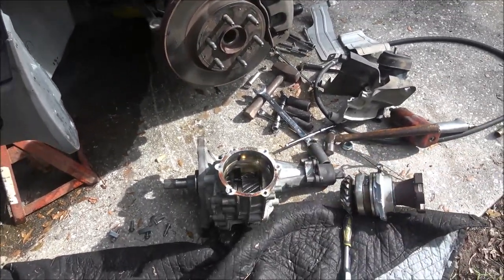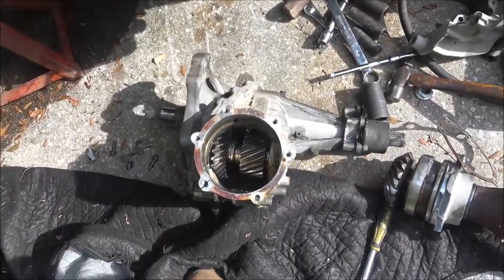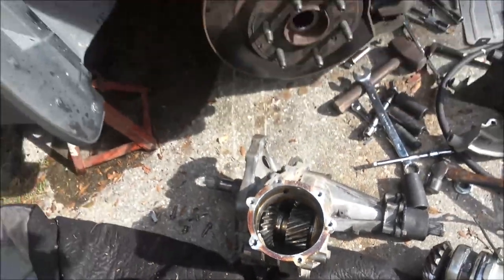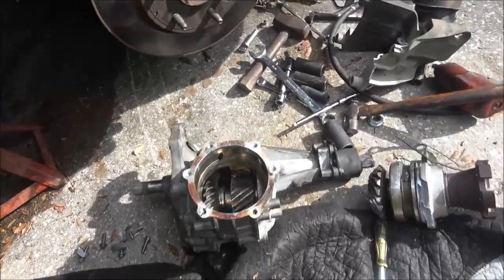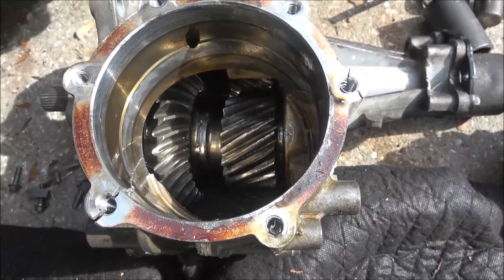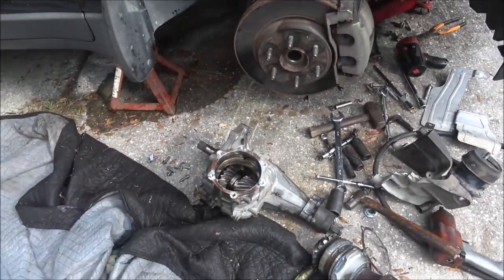That's a fluke thing. I thought we'd see a busted gear, but I'm not seeing busted gears. My guess would be, honestly to me, that looks like lack of maintenance. It almost looks like it was run empty. So always run maintenance on your stuff, guys. Always. This takes a 90 weight, so wow. All right, guys, I'll be back with you as soon as we get the other one unloaded. Well, as soon as it gets here and we get it unloaded.